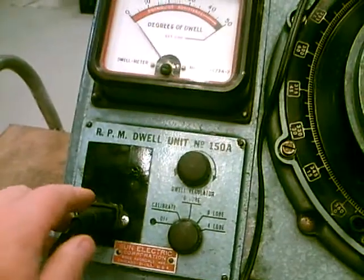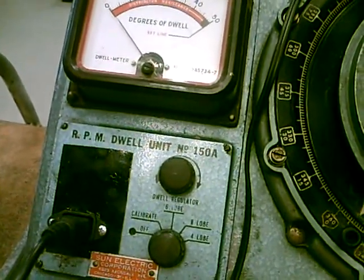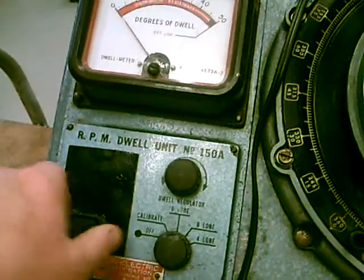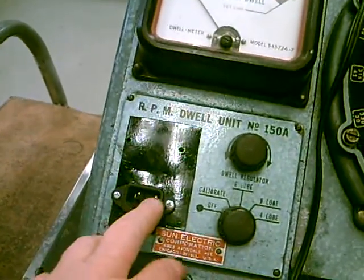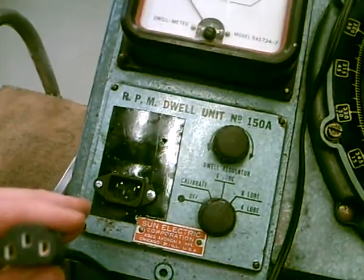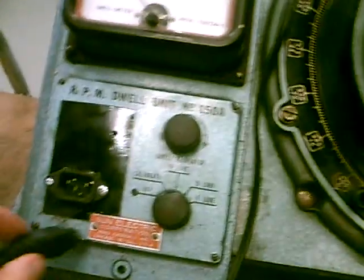We do a little thing here — we're not using batteries anymore because we have a 5-volt wall wart that we convert down to 3 volts with a couple of resistors. We use one of these IEC connectors. This is a standard connector you find on most electronics — it's got 3 holes, and everyone has a bunch of these lying around with cords and stuff.